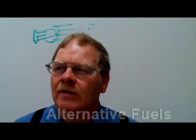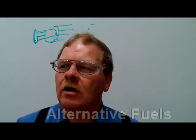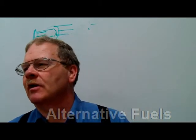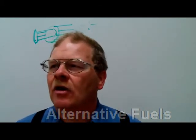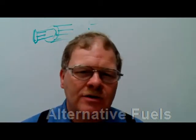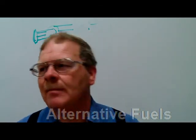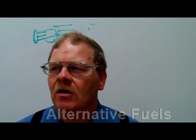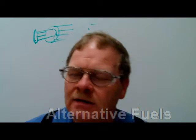And so what they have to do, if your car is set up, and we're on the next question, which deals with E85: if it's an E85 car, it can actually measure the amount of alcohol that's in the fuel and change the fueling strategy and the timing, because the combustion properties of the alcohol aren't as good as they are of gasoline. Got it? You see what I'm saying?